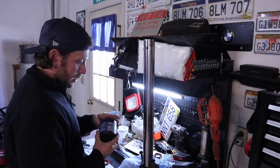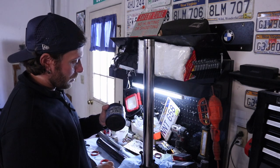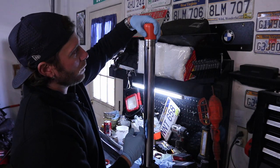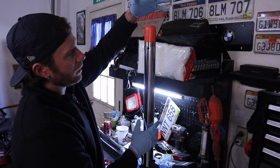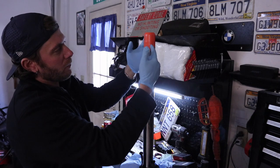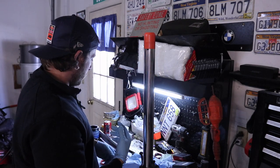So good idea to have a little tub of grease. And let me show you another tool you're gonna need here in order to get this done. All right, so this is a fork tool from Motion Pro. You get their specific size, I'll link it down in the description. That just sits down on here, that way we don't have that ridge there because we don't wanna cut our new seal when we go to put it on.